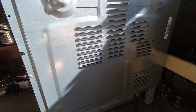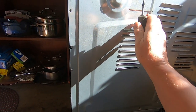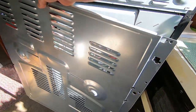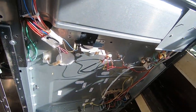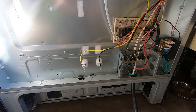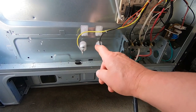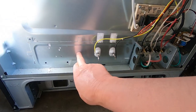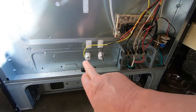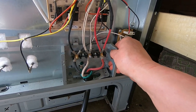It's unplugged, so I'm just going to take the Phillips head screws out of the back here holding this cover on. Cover's off, and looking in here you've got two terminals - this one and this one - and there's a little access door right here. This is where the hidden bake element is underneath.